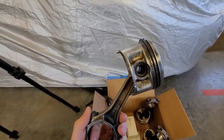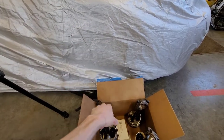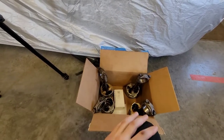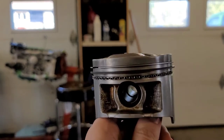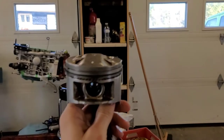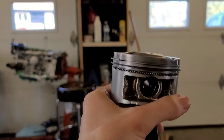After that, we'll show you which way to orient the openings in each ring, and then all that will be left is compressing and putting it into the block. Finished putting the rings on all of our pistons. These are all nice and fully loaded, ready to go. We're going to be dropping them into the block after we orientate the rings to the correct location. I'll show you now which way to orient your ring gaps - I'll probably put up a screenshot on screen of what I'm using to find out where to put them.